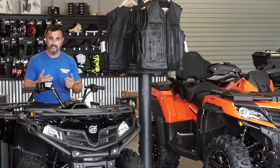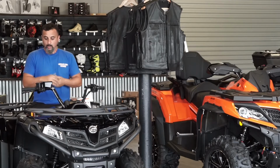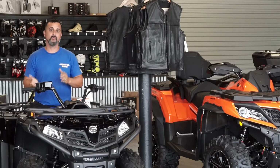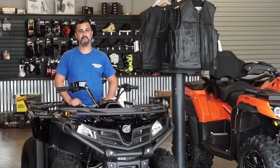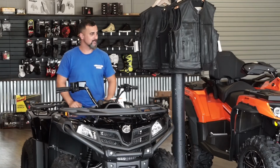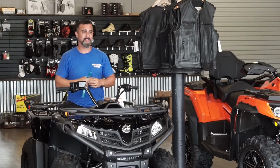Another thing, we've actually had a customer come in and talk to us, and his concern was rolling these units over. When you lift them and you put bigger tires on and you do things like that, you end up having more of a chance of a rollover. So the lower the vehicle is to the ground, the harder it is to roll over. Okay guys, another safety issue that a lot of people don't take into consideration is their winch. They think, I can never hurt myself with a winch, it moves very slow. That's not true. I've actually seen somebody get injured fairly bad from a winch. They gouged their finger pretty bad.